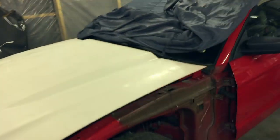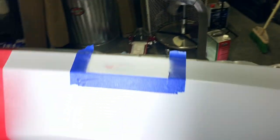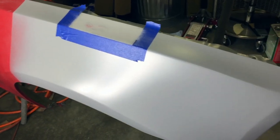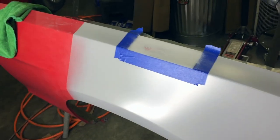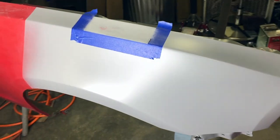So here's a little update: as you guys saw, I got the underside of the hood painted and now we've got it put back up and back on the car. Anywhere there's a little shiny area — you can see the reflection on there — I need to do some more scuffing, so there needs to be no shiny left on it. And I noticed after I had put this sealer on this fender that it's hard to tell when you're doing bodywork because you don't have a shine to see if you've got a high or a low, but there's just enough shine on that sealer.